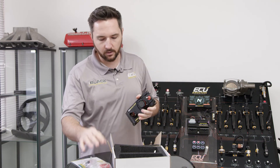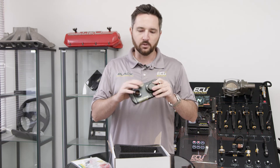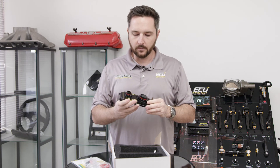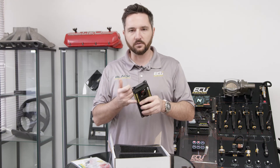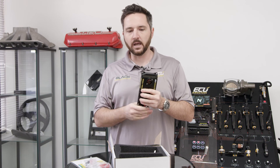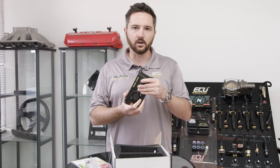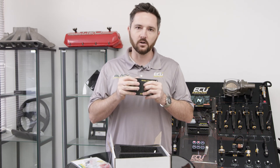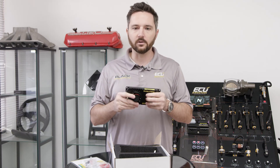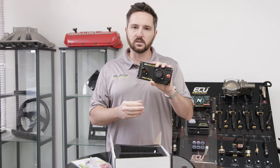Autosport connectors are included. It's programmable via CAN bus, just like the regular PMU. In terms of other functionality, it's the same as the regular PMU, aside from the different current capacity in the outputs and the additional six low-side outputs. It's a beautiful device — I love the form factor. The Autosport connectors are absolutely beautiful, and for serious racing in harsh conditions that need a really rugged connector, this is the solution. That is the PMU-16 Autosport.